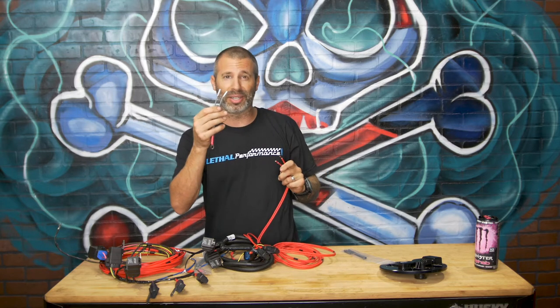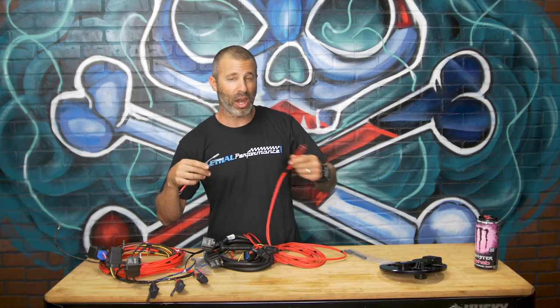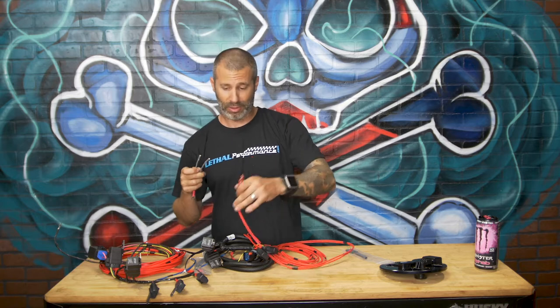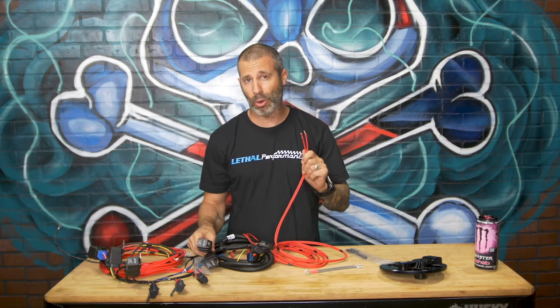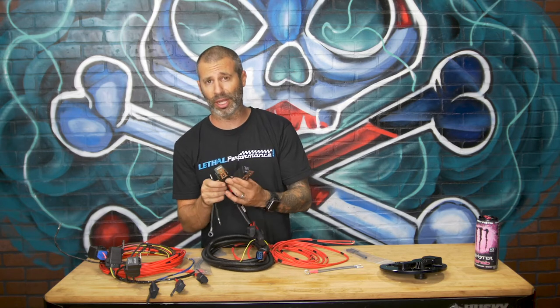What this does is if there's a short in between your battery distribution box and these relays anywhere in the wire, it's going to pop this fusible link because it's rated at 20 amps per wire. That's to protect the relays anywhere in between a relay and a battery. Your 10 gauge wiring power from your battery is going to be going to these relays right here — 40 amp relays.